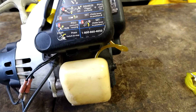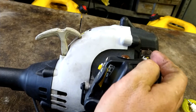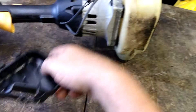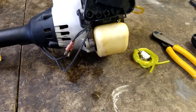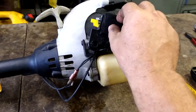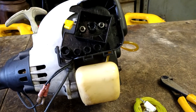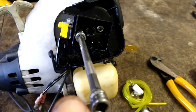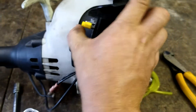First thing we're going to do is pop this air filter cover off. I'll put all the parts in the description — they come in a kit, and they even have the carburetor and everything, super cheap, so I'll get you that kit as well. Air filter off — we've got two 10-millimeter bolts. Take them off and we're going to pull this cover off. She likes to stick but she will come off, just stiff on the studs.